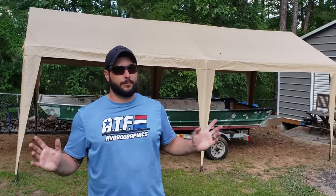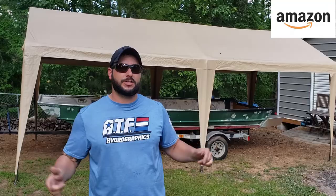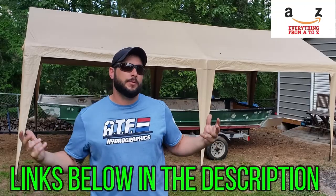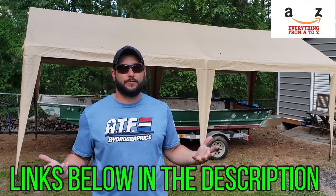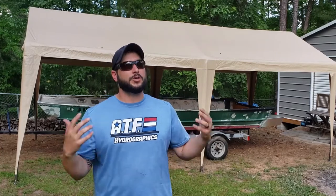So the first thing that we're going to need before we can paint our boat is something to cover the boat. I found this really cheap canopy on Amazon. It was like 160 bucks. I'll leave a link to it down in the description box below, but it's one of the cheapest ones I could find that actually had halfway decent quality. So our canopy is going to do a couple of things. One, it's going to help keep dust and dirt and debris from falling out of these pine trees and landing in our fresh paint job. It's also going to give us some shade so that we don't have to worry about direct sunlight messing with the dry time on the paint.